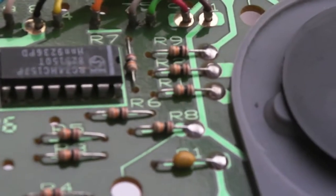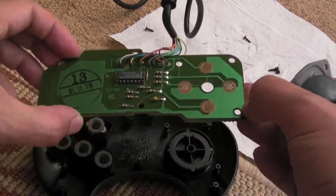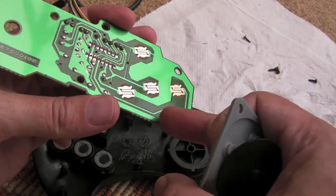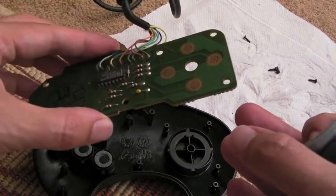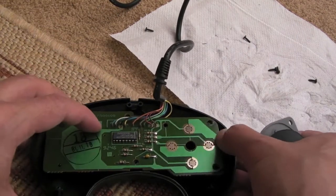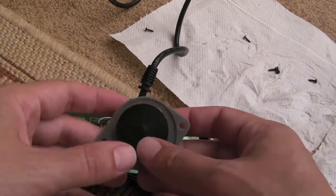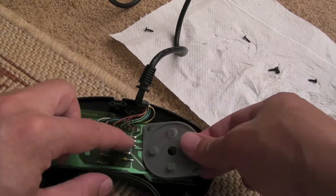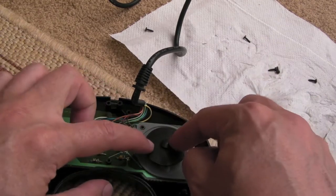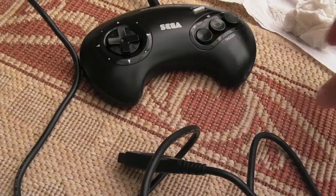Something else I just thought to show you — first time I've seen this. This must be one of the initial revisions of the Mega Drive controller, but you've got the D-pad directions on the opposite side to the buttons. So when you come to put it back together and you've never seen one like this before, you wonder which way around it goes. It can only go one way because of the mounts, so you put those in place first and it becomes apparent the D-pad goes this way up — it's inverted. If you push up it effectively goes down, press left it goes right, via this little hook mechanism.